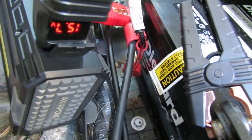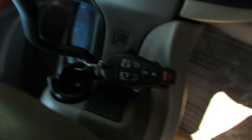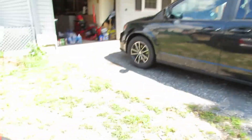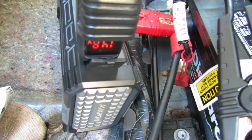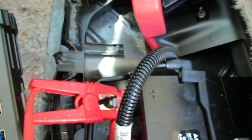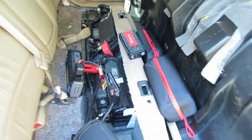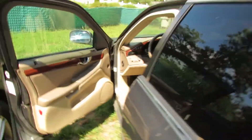Seeing 15.7 volts — everything's hooked up, 15.6. You hear the clicking, you hear the module working on the smart cables. The car started right up again. It's showing 14.5 volts and delivering power. This is the Avapow 6000 amp, and keep in mind all three units I just showed you do not have a boost button — that's why we're performing this test.